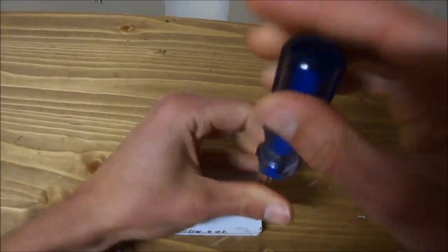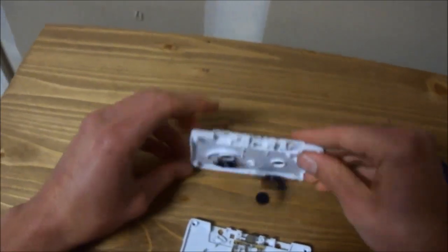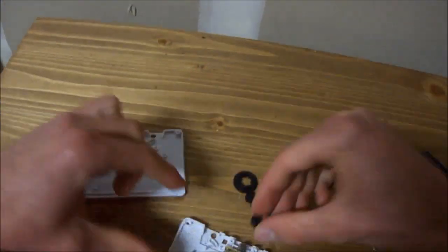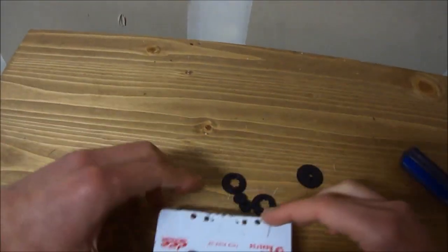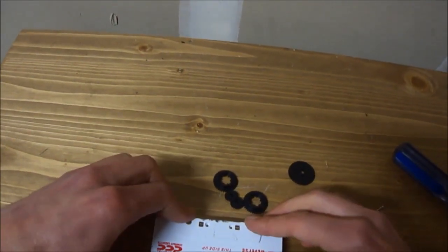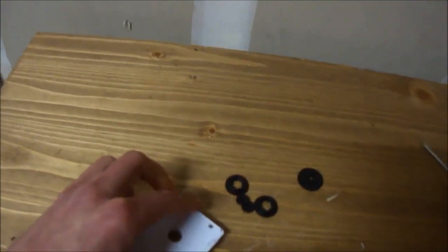Kidding me? Plan B. Remove all gears except for the ejector gear that was previously lubricated. Removing all of these gears may reduce the possibility for interior mechanisms from catching, which stop the player from recognizing or priming the cassette. It also serves to reduce cassette noise during play.